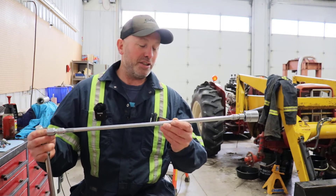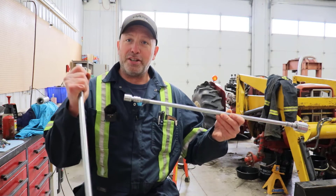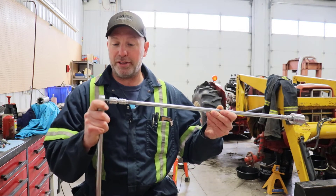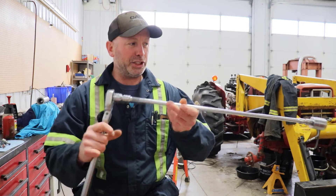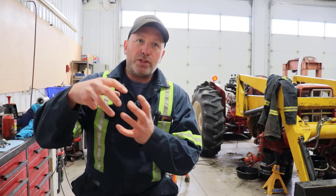This extension is going to be our pretend crankshaft, and this ratchet is going to be the throw on the crankshaft. If we think about a crankshaft, it's just a shaft with throws around the outside. When we bolt weights onto the throws to simulate the same weight as a connecting rod and piston, and we spin that crankshaft, it'll be perfectly balanced — smooth as can be. But something happens in a running engine that requires the harmonic balancer.